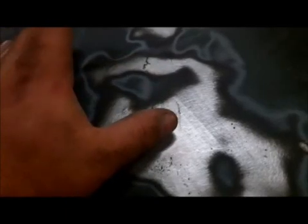Guys, so you see here we obviously hit bare metal. We're through primer, we're through the factory e-coat, we're through everything, right down to bare metal. You guys are saying, well, can you use a coarser grit? You can, yeah. You can use 80 grit if you want. But the thing is once that sandpaper hits this bare metal, 80 grit's going to leave scratches into that metal. Alright? 180's also going to leave scratches, but they're a lot finer, and the primer will easily cover that. Okay? Like I said, this is a budget job. I don't want to put epoxy primer on this hood.